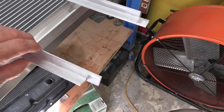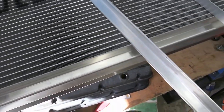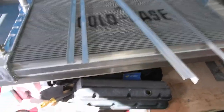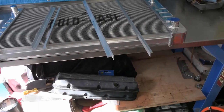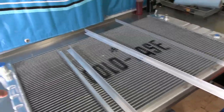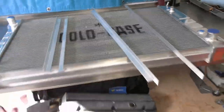That's how I ended up cutting these pieces to have the little notches on them — it cuts them out perfectly. Usually when you do a radiator, some people take a measurement from one corner to the other and try to make a perfectly squared-out framing. Not all radiators are perfectly square. I will say that Cold Case radiators are square — when I made the frame and measured corner to corner, this sucker was square. Kudos to Cold Case for that.